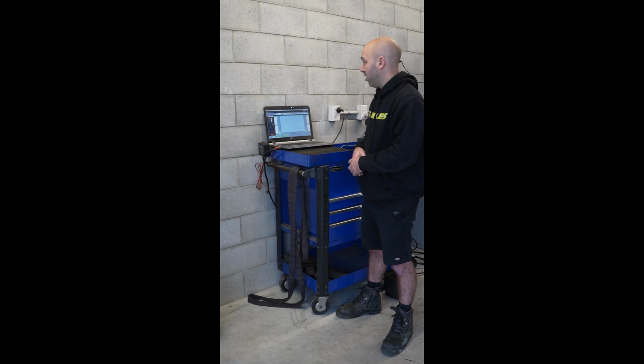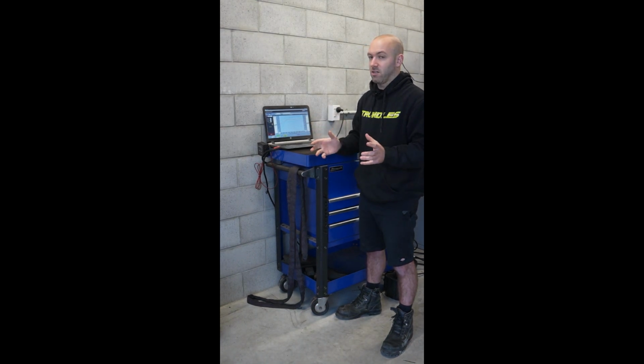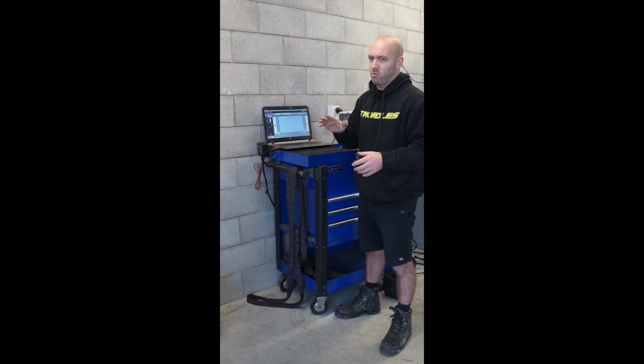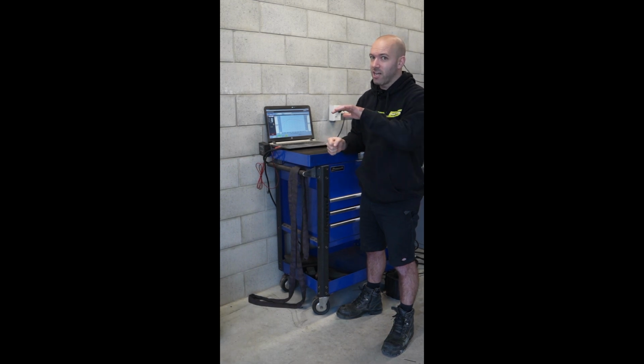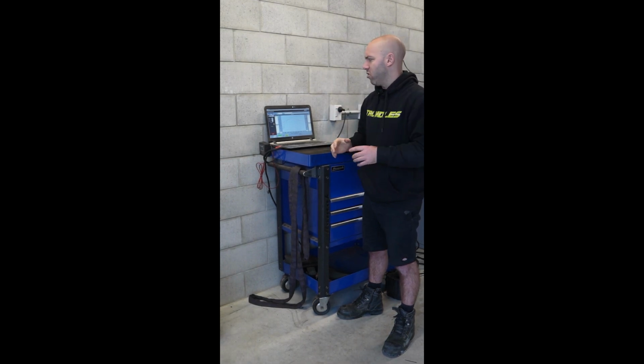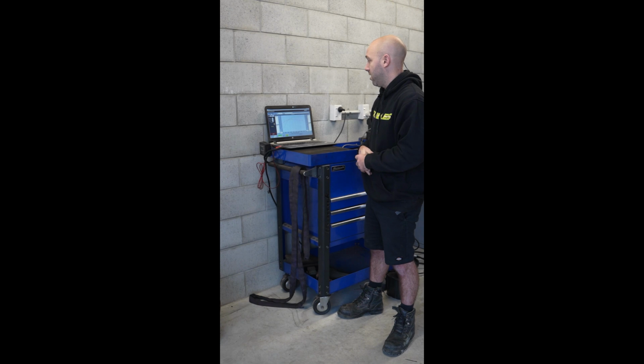As far as the power goes, it was making a bit more before, but it's due to this boost spike. I've had 2 different wastegates, actually 3, on one of my rotaries, and the 50 was a little bit small and it would hold boost into the top end, and then when I put a 60 on it, it would actually fall off a little bit. You can see this effect from exhaust manifold pressure, and I believe that's the case in this scenario. We will do a bit more testing on that.